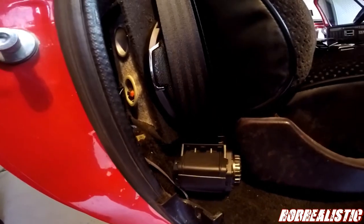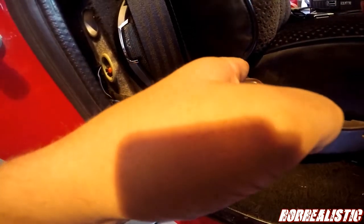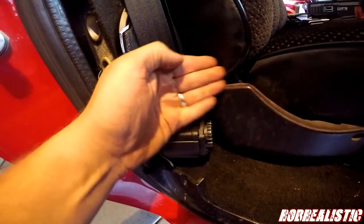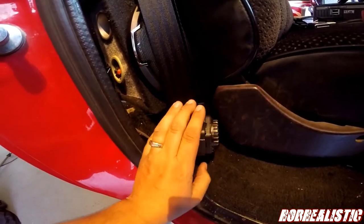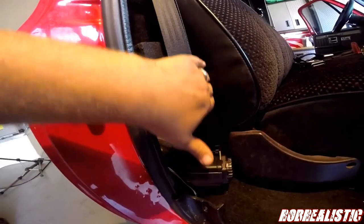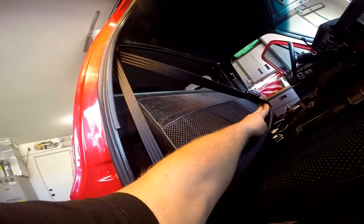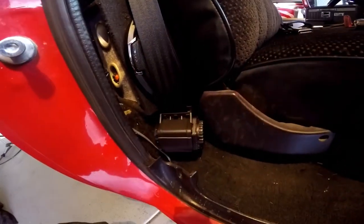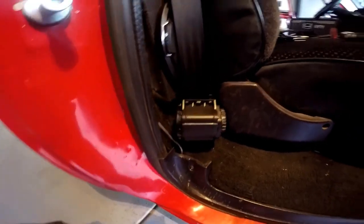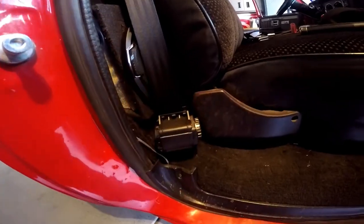This is probably not one of my best videos, but somebody might buy this kit and have the same problem I had — thinking it goes in tucked behind the door. If you put the L bracket facing in, your seat won't come back as far. Also the twist in the belt irritates me — but when you go over your shoulder, that twist goes flat on your lap and flat across your shoulder, which is how a seat belt should be. Alright guys, that wraps it up — I'll finalize everything and catch you at the next C10 video. Peace — Rob Realistics out.